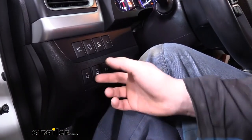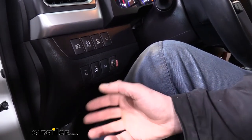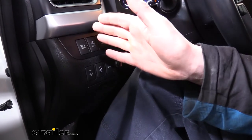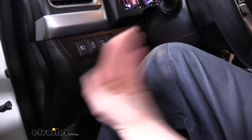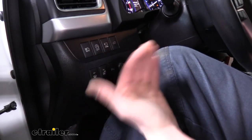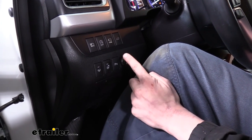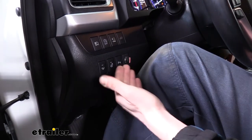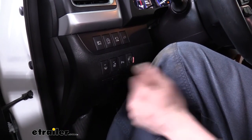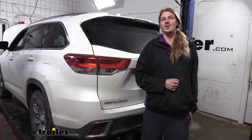Now that we've verified everything's working properly, the Redarc needs to be programmed before it will function as intended. This is because it's designed to mount in any orientation — so you take it out, drive in a straight line, and hit the brakes. Every time you start and stop, it detects that inertia movement and learns what orientation it's in. Once it finishes its calibration process, your controller will be up and running. If you have a trailer hooked up, you'll see it flashing between blue and green, meaning it needs to be programmed. The flashing gets faster as it gets closer to being fully programmed. Once it's finally programmed, it'll turn blue. And that completes our installation of Redarc's TowPro Elite Brake Controller on our 2018 Toyota Highlander.